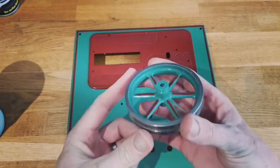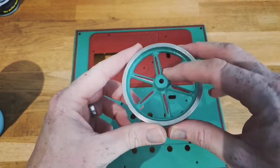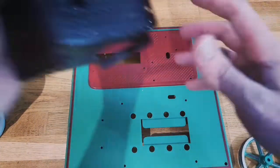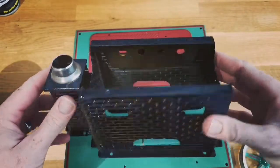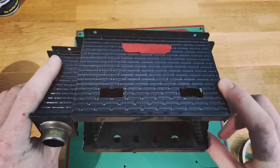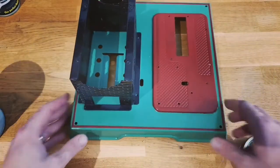I have hand brushed the flywheel — this is just the paint finish, so it's naturally a gloss finish, about 85-90% gloss, just a slight satin to it. I have also painted the engine cowling. I've got a blast cabinet which I put this in, along with a couple of other bits, to take the paint off. That has been painted with gloss black engine enamel, so again that should be fine with the heat going through it.